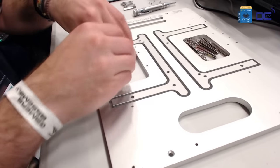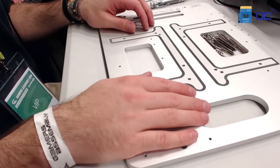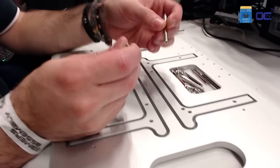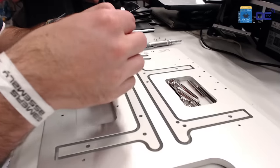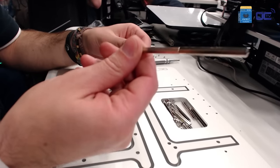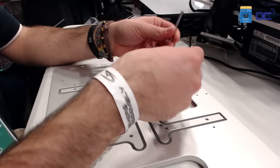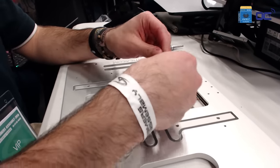So that was just the first part of the compartment. You can see it fits a lot of useful stuff inside — pretty much all the standoffs for your motherboard. In the other compartment, we have higher standoffs that are four centimeters high. And guess what? For the graphics card, two times four. So you can put them like that to have your motherboard higher up, or put them like this and use them as a standoff for the graphics card — it replaces the PCI Express mount of your chassis.